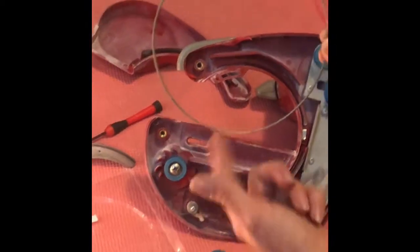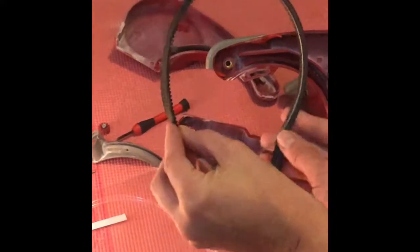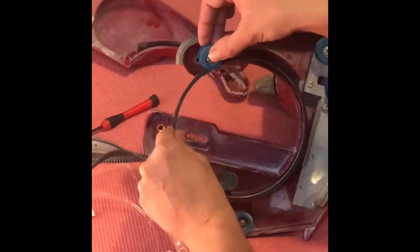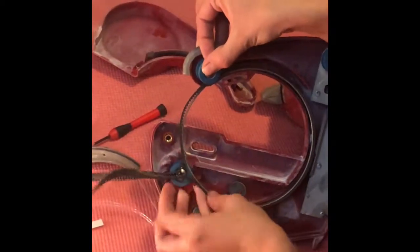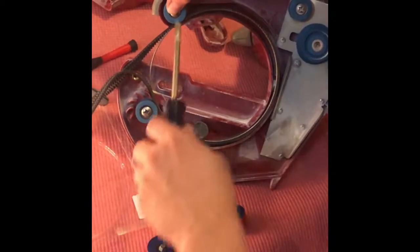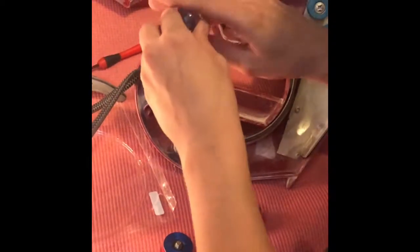New blade is coming on. So what we're going to do is take the belt with that groove and wind it around — it sets really nice in the belt. So once it's in there, you can hold it, just like that. In it goes. Now this is kind of a tricky part: as you're putting this in, you're also putting this in at the same time. This sets right here, so as you set this guy in, line this up. Once that's all lined up, you can screw this in. Making sure you do not pinch the belt — this belt wants to get pinched. Just watch everything.